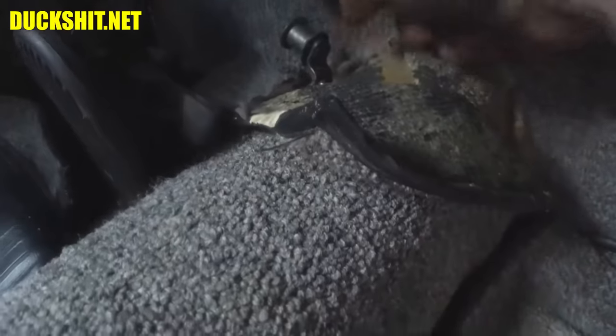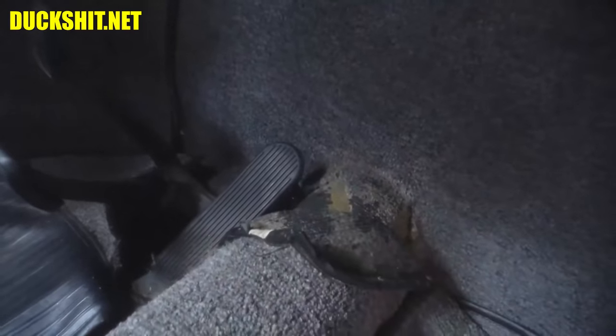All right. I can see a little twinkle down there in the throttle lever. See that little light spot? That is actually the little hole where the little Z-end is supposed to go into. I've never done this work from the passenger side before, but I'm going to say this is a lot easier for somebody my size. There it is. See how that's just kind of put through that hole? Now we have a working throttle. Of course, there's nothing holding it on the other side of the engine yet, but we're about to work on that. But essentially, we can call that just about done.